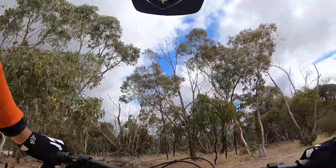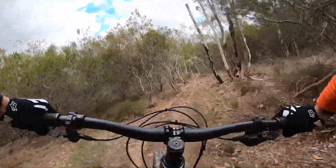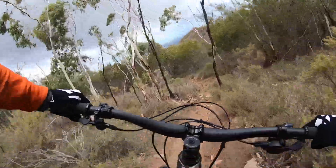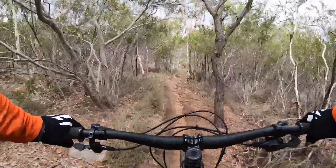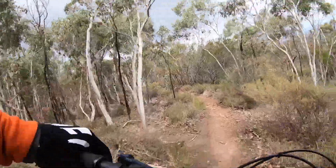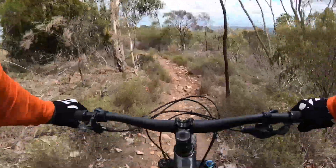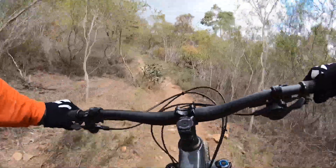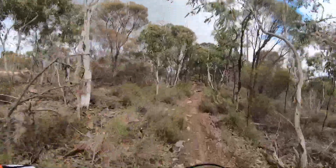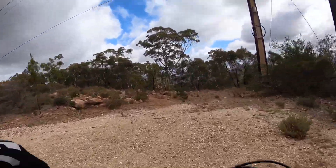This is Loop Tree Trail at Ernsties Hill on the Slayer 29 — I've just dropped a run of Wildside. A little bit firm at the back, so I'd definitely like a lighter spring for sure. Just can't quite settle into it. When you get these choppy little rocky bumps, instead of it being compliant, it's just getting bounced off everything. Not as abrupt as if it was an air shock over-sprung, most certainly, but still not controlled.